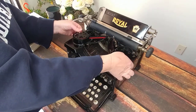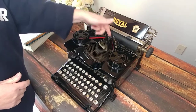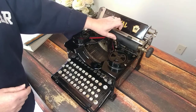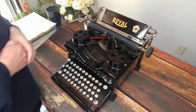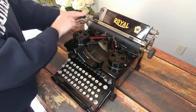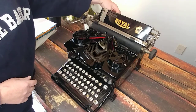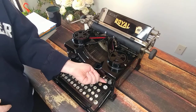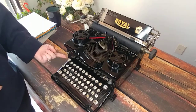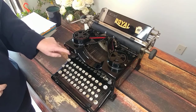You just see these little knobs — pull those back and lift these up and out. If you press this, it pops these back. I honestly have no idea why you would want to pop back your paper guides, but that's what it does. Right here is your single, double, and triple line advance for when you hit your return — I have it on triple; I'll put it back to single. Behind here, where you can't see, is where you set your margins. This is the margin release, and on this typewriter the margin release does not work.